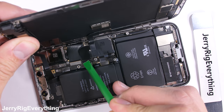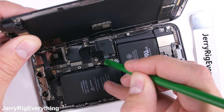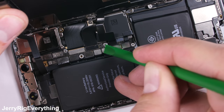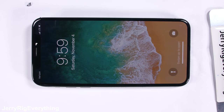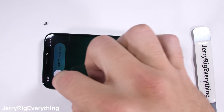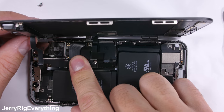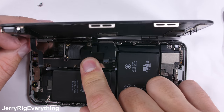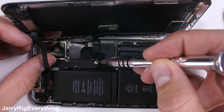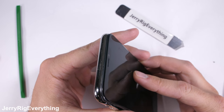With the battery in place and the 3 ribbons coming from the screen all reattached to that center connector bridge, I can finally plug in the battery — it goes in last, just to be safe. I'll test the phone out before adding that metal plate just to make sure everything is working. If there are lines going through your display, or it's gray, or nothing shows up, it might just be a bad connection — re-seat those little Lego connectors and try again. With the phone confirmed working, the metal plate slides into place with its 5 screws. All of these are different sizes, so they need to go back in the same hole they came from. Finally, the phone can fold shut just like a little book and clip down into place.